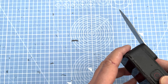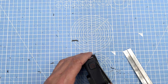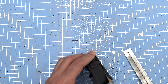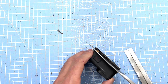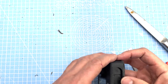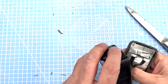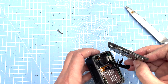You can see I've made a little bit of a mess on the sides. You can use a blade or a Dremel to get a smoother edge. We've gone through the glue and it's starting to open up — a bit more heat. There we go, it came off. Be careful not to yank out the ribbon cables; click them off carefully. There's some sticky tape in there as well which we don't actually need.